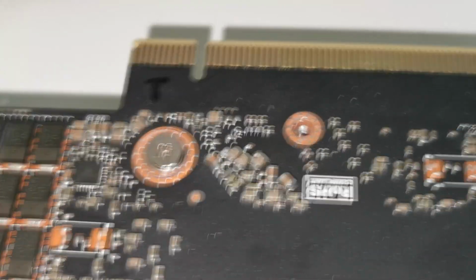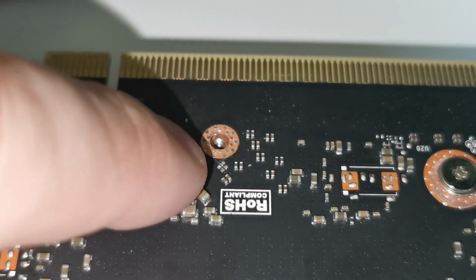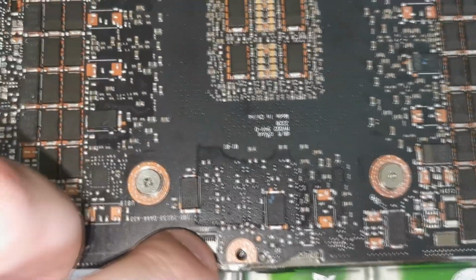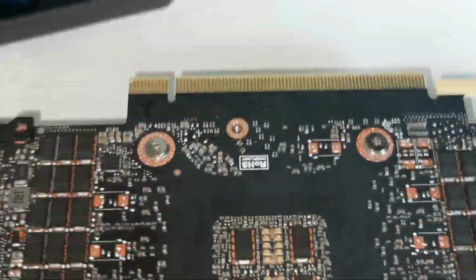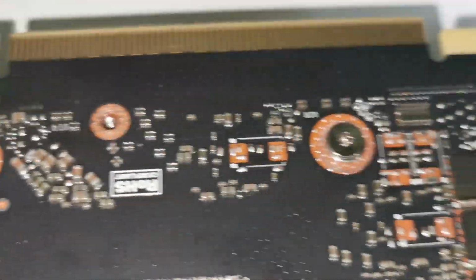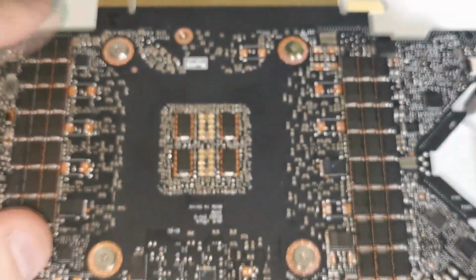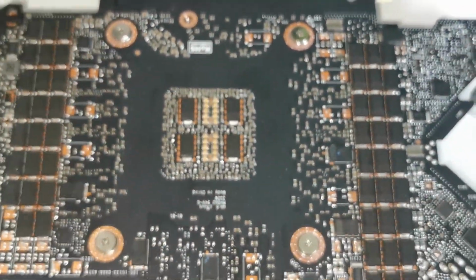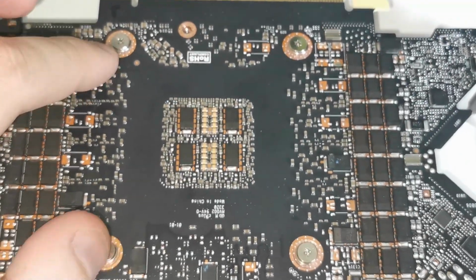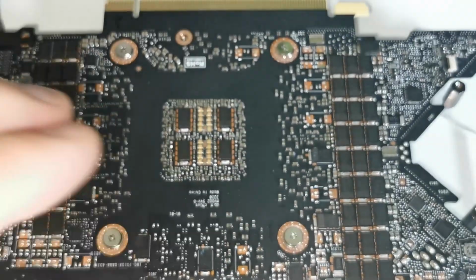And don't put washers into those holes, because the washers that come in the package are too big and they will not even affect how the holding is done. The whole instruction manual is just pointless. Those 2 holes are meant for backplate mounting. Don't use them with those springy screws as the manual implies. Only use plastic washers with 4 screws around the chip itself, and don't use washers with anything else.